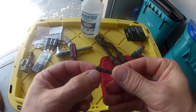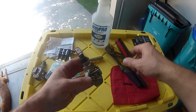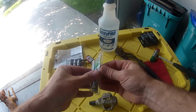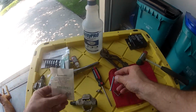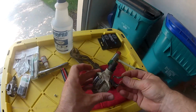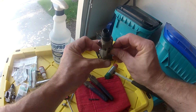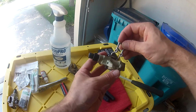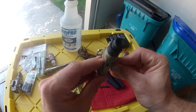So the little knurling that they had on this didn't have enough bite on the body there, and it allows it to slip. Anyways, so you get that, get you a machine screw and a nut ready. So it goes in one way, you'll see how it lines up, just like that. When you're looking at the pedal, the short side of the bracket and then the smooth part goes to the body, and then just hold that with your bottom fingers here.